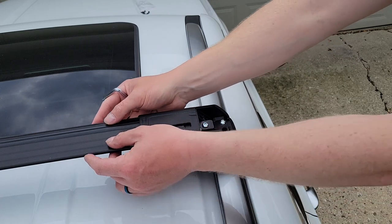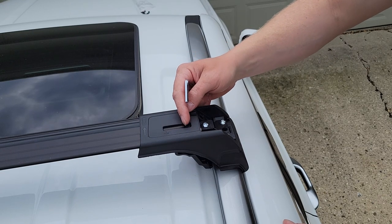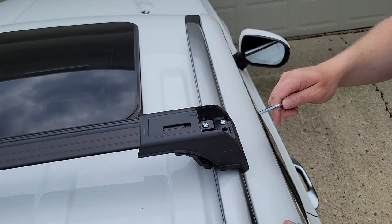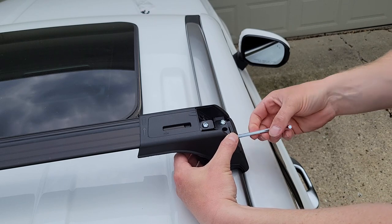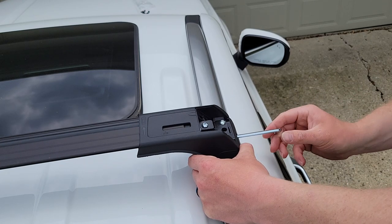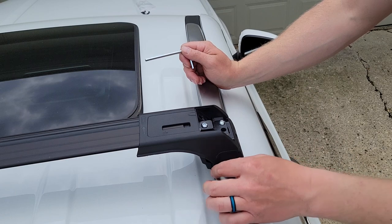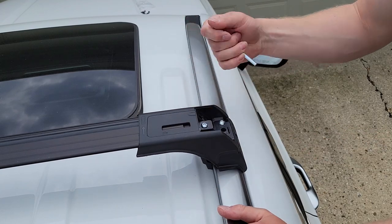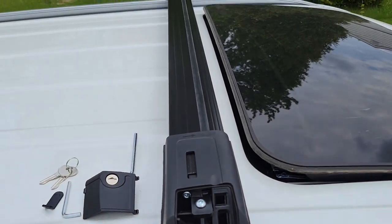Both the front of the bar is at 21 inches on both sides. You can slide the bar back and forth in the housings — I have it set at roughly one-and-a-quarter to one-and-a-half on both sides (it goes from one to four), so it's equally placed between the two mounts. Go ahead and start tightening your clamps using the main larger allen head bolt down below, making sure it doesn't move forward or back. Snug up both sides and make sure your rubber mounts are not folding.